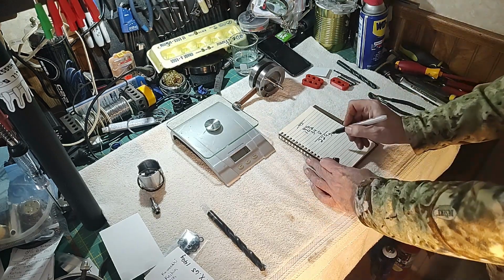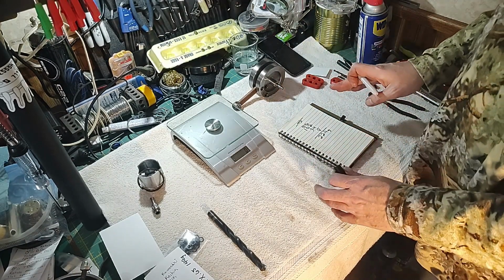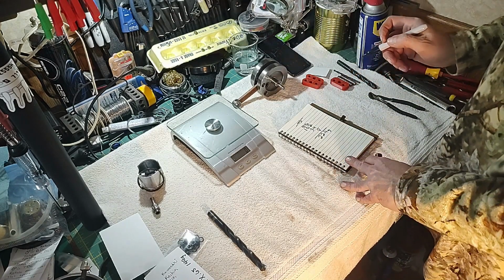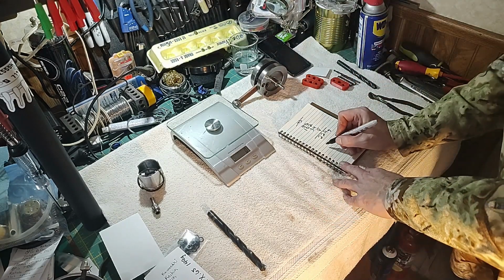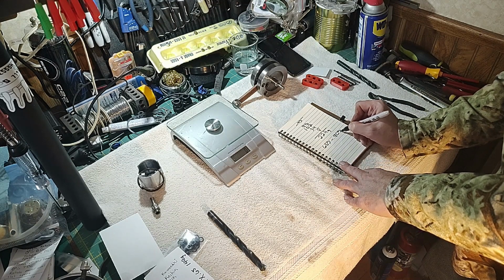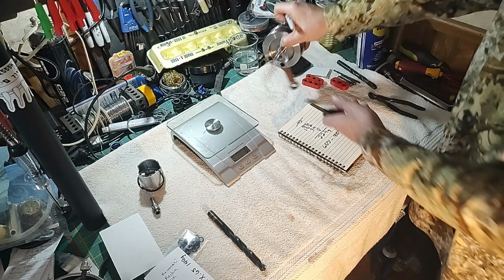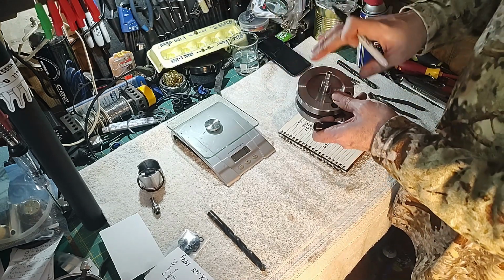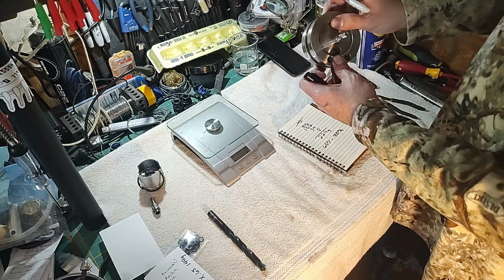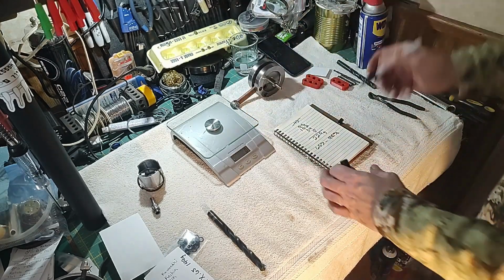So now there's the factor of the balance factor. We don't have to get a perfect 229 balance of counterweight, as long as we get about 65% of that, we're pretty good. What you're wanting is 65% to 80%. You don't want to go above 80 either, because then you'll start having issues with the weights on this side. You'll have to add a weight over here, and then you have to try to get this balanced. It'll start wobbling. So that's pretty much the numbers there.